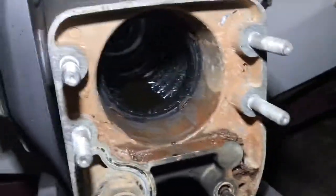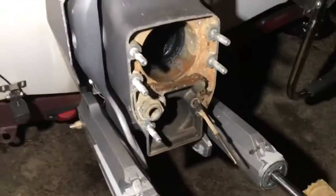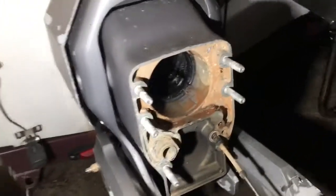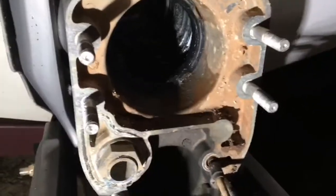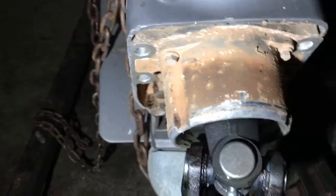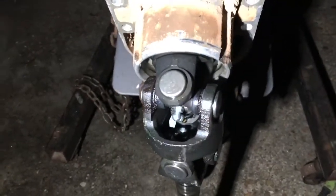It's free and out, which is a good thing. Pulling a Volvo Penta outdrive is not as hard as a Mercury, actually. There are two gaskets: one goes around the water seal that seals your water system, which I'll replace, and there's a gasket inside here — that nose butts up against that gasket, which is what seals water out of the drive system. It's working because there was no water in there, so that's a good thing. I'll wrap it up for tonight and post this to YouTube — thanks for watching.